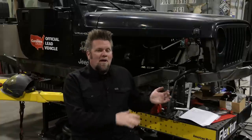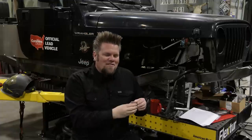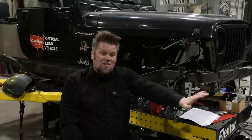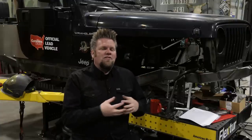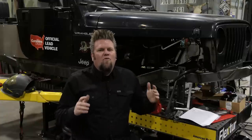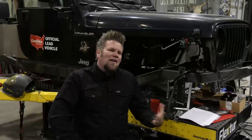So that is a safety thing that not a lot of people realize — the reason we have air tools in a shop is because when you have an electric drill or electric impact, you are in the presence of explosive vapors with an item that creates sparks. Whether you choose to use the electric impact over the air impact is completely your choice. I'm a fan of the air impact just because that's what I started with. When I was a teenager dreaming of being a mechanic, the gas station where I had a summer job was across the street from a shop, and I used to sit there and listen to the sound of the impact guns and just dreamt of one day being able to work in a shop and make that sound.